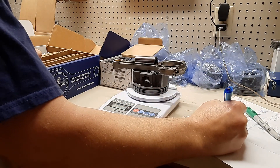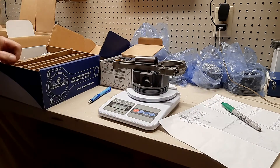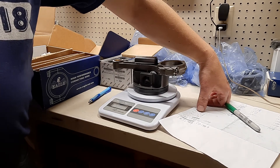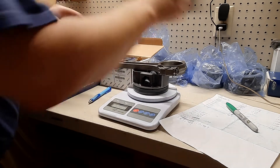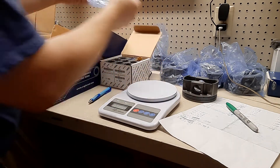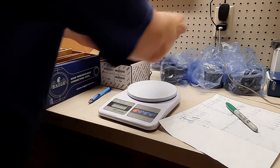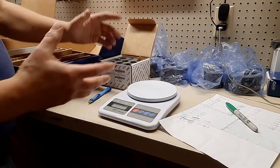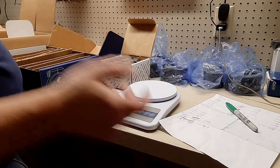I might have some more switching I can do. I still have number four at 1387, so let's swap him out with number four and number one. These are all properly marked now. I know this is not what you would do with a high-end racing engine, but for what I'm doing this is going to balance out each assembly to be very close. This also helps us get rid of the rounding error from the scale. I didn't buy a real expensive scale - it doesn't go to tenths of grams, it's whole grams, so this also helps with some of the rounding error.